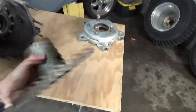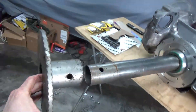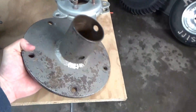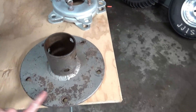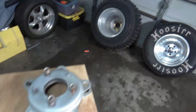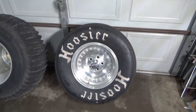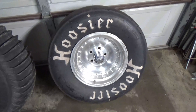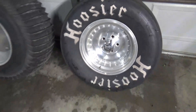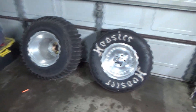I've still got a couple more to cut for the bottom to strengthen that up, but this is really going to look nice and be quite a bit stronger than a stock case. But more on that later — we're not really here to talk about that today. On our transaxle, we have our rotor here that fits right on here. This was all set up for fan drags, so it has a Volkswagen wide five bolt pattern. The problem is, this would be the Volkswagen wide five bolt pattern for paddles, but I would also like to run slicks on this, and I have a set of Centerline wheels with a Chevy 4.75 bolt pattern. So I want to get the Chevy bolt pattern on there where I can be versatile — run both my paddles and my slicks.